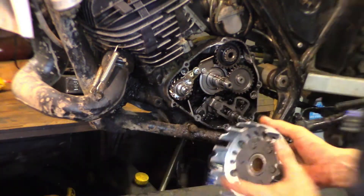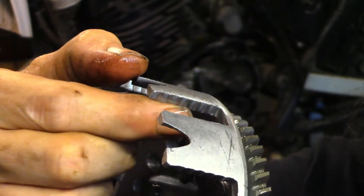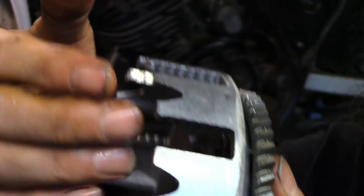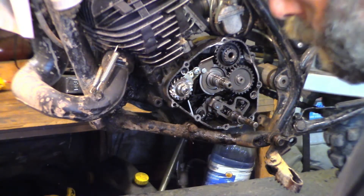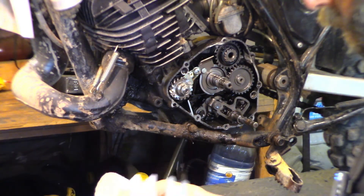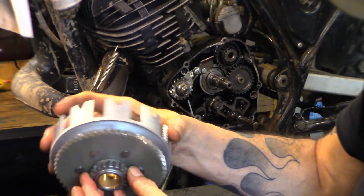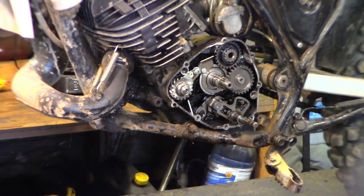Let me show you these grooves. I'm not sure if the camera's going to play tricks on us. There — you can see them. See those grooves? They're not severe, I have seen far worse, but that's where the teeth of the clutch friction disc sit, and that's the drive side. What we're going to do is take a flat file and very carefully file those edges down until there are no longer grooves. I'm going to put a set of soft jaws on my vise, clamp down on the ring gear here which shows very little wear, and file until the high spots are gone. You don't want to take off too much material, just enough to take the high spots out. I'll fire the camera back on when that's done.